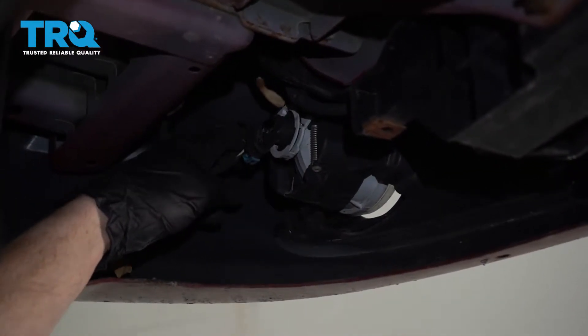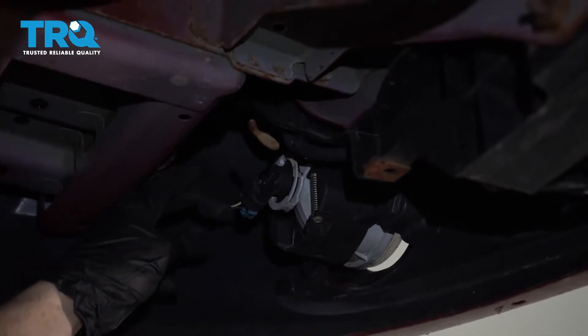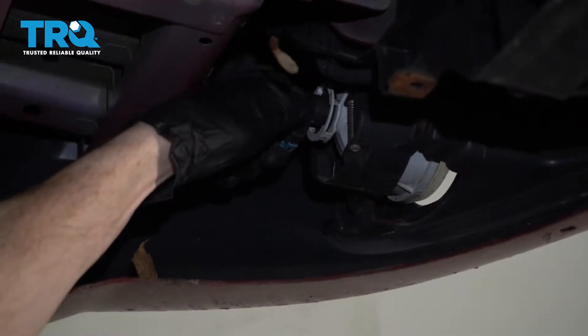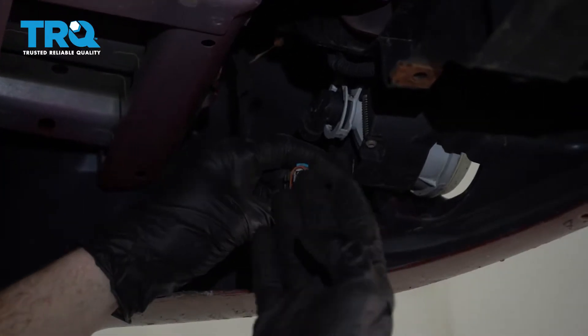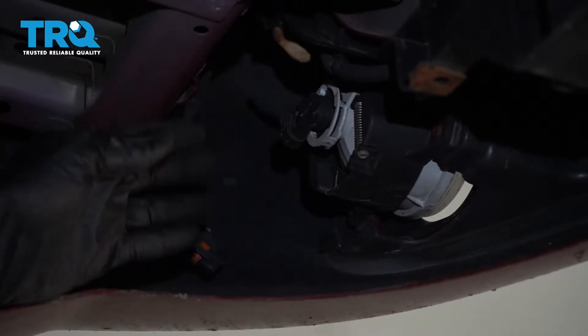Let's go ahead and grab this, get it right out of the way. Now at this point, we can make our way right up to the backside of that fog lamp assembly. You're going to find a pigtail, which is the wiring. I'm just going to grab onto this tab where my thumb is and carefully pull it away. Every time you remove an electrical connector, you just want to inspect it — if you see any funny colors, it's corrosion and it needs to be dealt with. That looks fine, so let's continue.